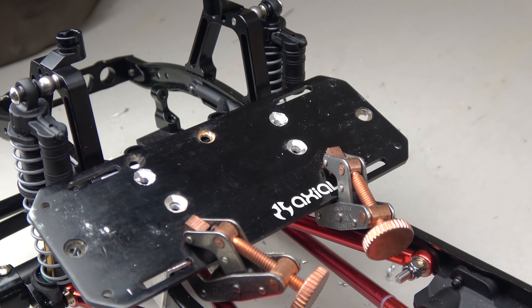The final step is to mount the battery plate to the angle aluminum pieces you made. You need to run your battery strap through the plate first because it gets sandwiched between the two pieces of aluminum. Make sure that your battery strap functions properly still, because it is not adjustable once you do this. Once your plate is all mounted up, you now have one of the best cheap and easy performance mods for your SCX-10. Your new low center of gravity will make your truck crawl amazing.